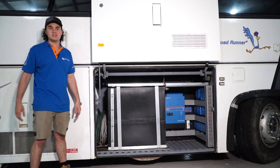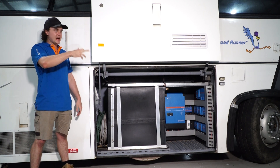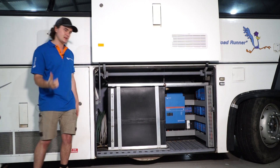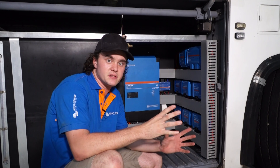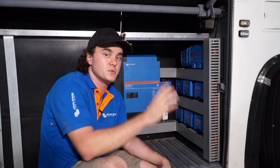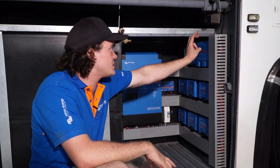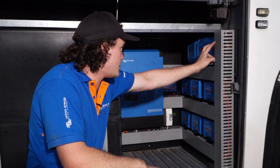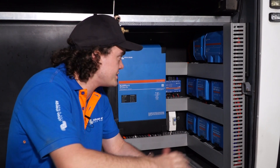With this big rig taking up so much space in our workshop, we had all hands on deck. Vince gave you a run through of what we've done on top, Adam gave you a run through of what we've done inside, and now I'll give you a run through the electronics area. We've had Craig run a big 24-volt line from the starter at the rear right up to here, onto some poles where we've paralleled these three DC-DC converters, responsible for the alternator charging.